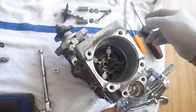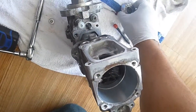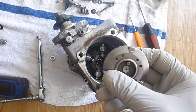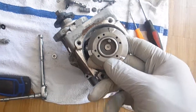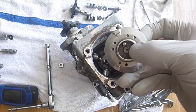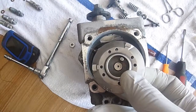I really wanted to show that because the sprocket is in time - you can see it down there, right there. This is the cam gear, the one that actually does the lifting and pushes the high pressure pump in the head. You need to make sure that it is offset. Some people say about the 2 o'clock position. You don't want it down in this position when you do your reassembly or it's going to be 180 degrees out of time. So you do it there. Let me line up with the pump body so you see - roughly it's right about there.